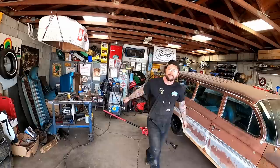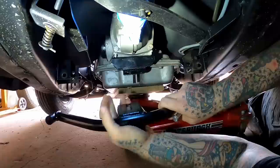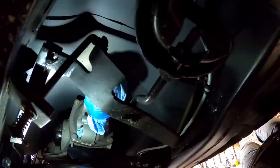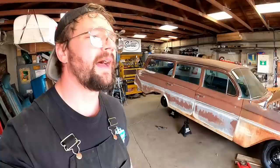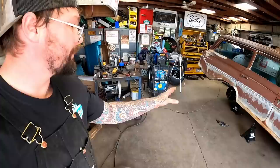You like my hat style right now? Better be careful with this sucker sideways as I do one of these - I probably look like I'm in the 80s getting ready to break dance. They called me Hop Around Harold - we're gonna shimmy shake our way down in here. Now fabricated on this piece for hours - let's see if she fits. She's in. As long as we end up with room for our slip yoke and everything to clear, we should be good. Earlier y'all heard me say I got a disc-disc proportioning valve, but we ain't got no rear brakes yet. We're about to rebuild the drums and then I might have to put on the disc-drum proportioning valve - just playing. I did order a disc brake kit for this.